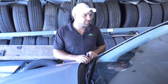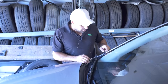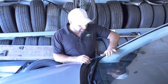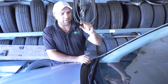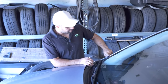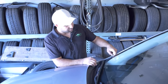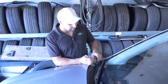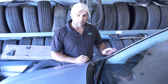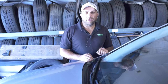That cost me another $200-$300 to replace the windshield again. So just telling you from experience — when the glass guy puts the new glass in, make sure they push it down as far as possible. You need that gap between the pillar and the windshield because if the clip can't go in, this thing is going to sit too high and you're going to be wondering what happened. That's the experience I've had with that. Alright, bye.